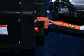The third emergency shutdown procedure involves the red service switch on the PEC. In this case, the driver should push the service switch and shut down the engine. This will disable the hybrid system. Please note that the red service switch should only be used in an emergency shutdown or when the service manual or troubleshooting guide directs the hybrid trained technician to perform work on the high voltage system.